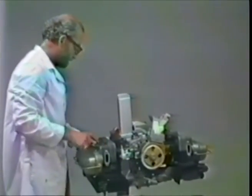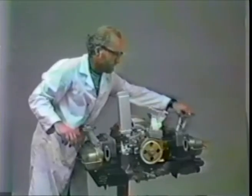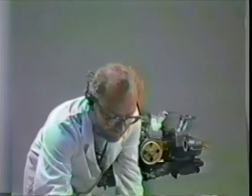You grab the Solex manifold gaskets, and you don't have to use any mucilage on them unless you want to. I normally don't, that way they come off pretty easily. And you put the Solex manifold gaskets on both sides. You simply take the Solex manifolds, set them on the gasket. They go on this way, of course, and they're identical manifolds. Take the washers and studs and arrange them as I described